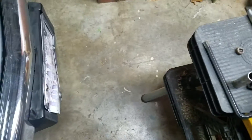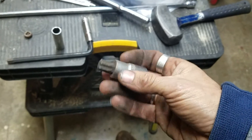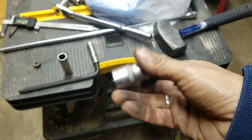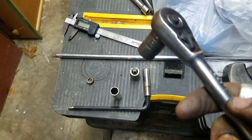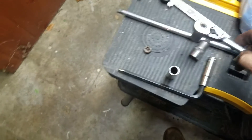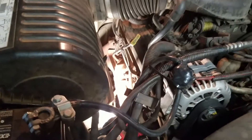Installing it got a little tricky. The plug takes roughly a half-inch square drive. I took a T60 Torx bit, put it onto the plug so the square end sticks out, then slipped an E16 inverted Torx over it — and boom, made myself a square driver on the spot. You've got to think about this kind of stuff doing mobile mechanic work. You show up and do whatever it takes, however it takes, because you never know what you're going to run into. If you can't think outside the box, you won't make it. Learn to make your own tools when you need one.